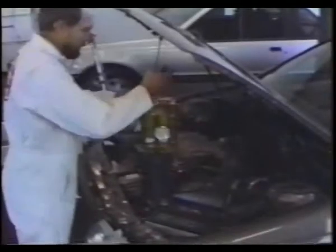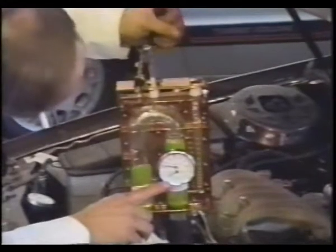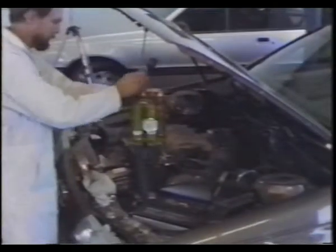Step 4. After analyzer is filled from the filling bottle, plug in bulb pump with valve closed. Pump pressure into system to 10 to 17 psi. Disconnect pump. Inspect for water leakage from entire cooling system. Once inspection is done, plug in bulb pump and release pressure from system with valve on pump. Disconnect pump. If needed, add coolant to system with filler bottle and disconnect filler bottle.